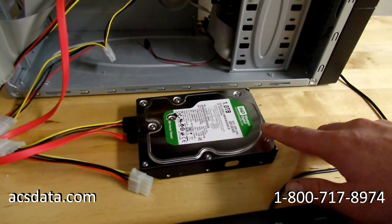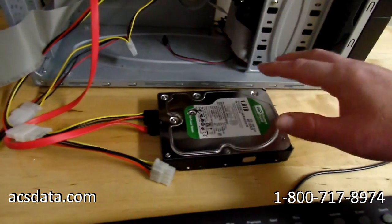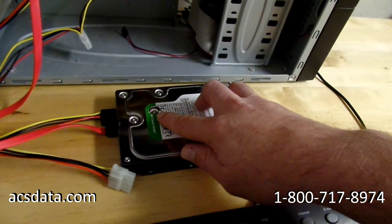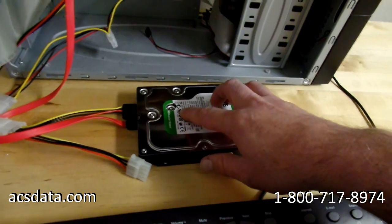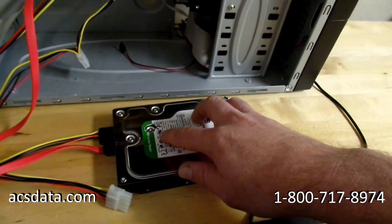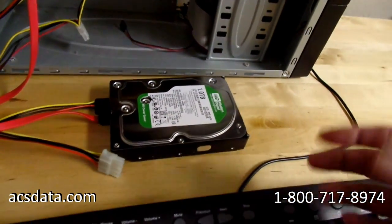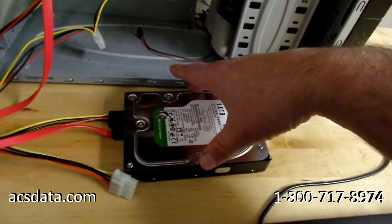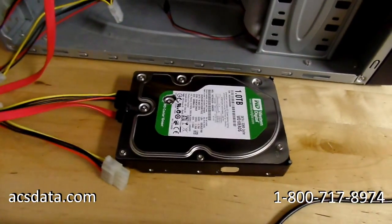It's really odd with Western Digital drives compared to others. Most hard drives are manufactured with the platters already having some of the data written to them, servo tracks and things like that, because then the heads are actually anchored to the drive chassis, so the alignments are always going to be the same from drive to drive. There's really not any variation. But if you may have recalled when we disassembled this drive, we didn't really unscrew anything to remove the heads. We just worked them up off of the shaft in there. We just slid them up, and that was pretty much how a lot of Western Digitals are. So it's how they're assembled, and the platters go in there blank. The heads slip down over that shaft. The drive case cover is then put in place, and that is when the initial head alignment is essentially set.